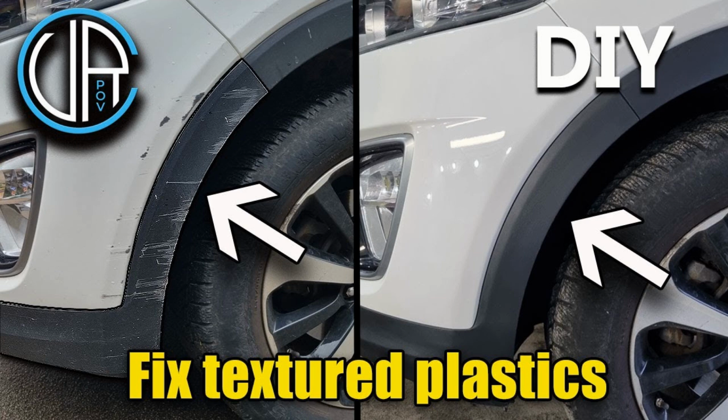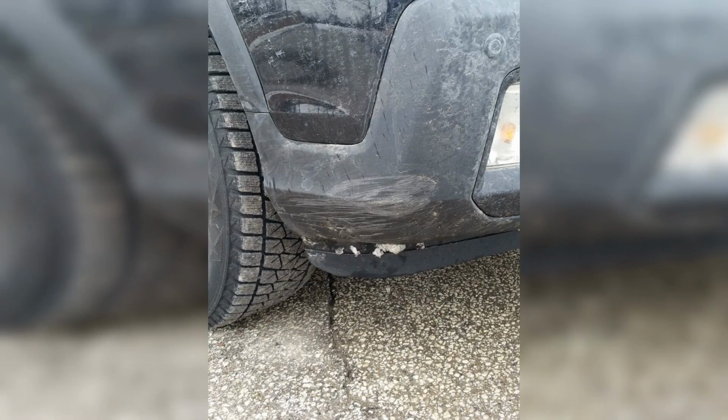1. Polish the scratch with sandpaper. Wet your 3000 grit sandpaper and gently sand the scratch. Do this until the scratch is no longer visible. Alternatively, you can use toothpaste to polish this type of scratch. It works like 3000 grit sandpaper, but also polishes the affected surface.